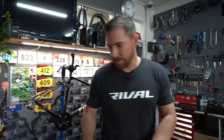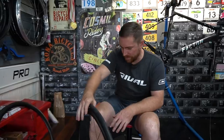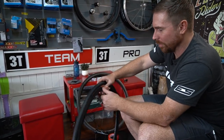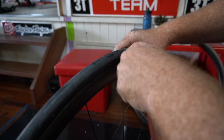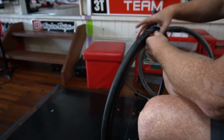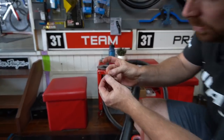So I will put a little bit more air in it now. You don't want to go any more than probably 80 — I'll just have a look — probably go 60 I'd say. This is the finishing touch, it's this easy. Now you've got that tape that you pulled out earlier — if you didn't pull it out, you had to take the tire off again. So now just gently, very slowly — I can do it with the two finger pinch. And because you've got plenty of pressure in there now, the tire's not moving. You've really got it. You don't want to pull this way, you've got to pull backwards like this. It's very easy. This is the finishing bit which will pop out — and there's my little cut there — it's come all the way off on both ends.